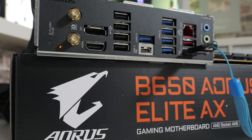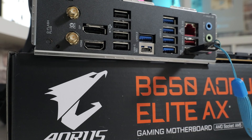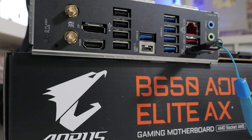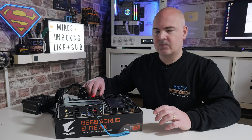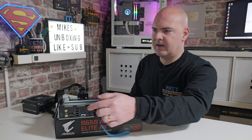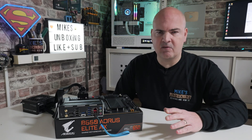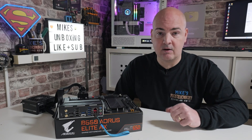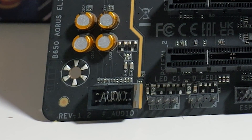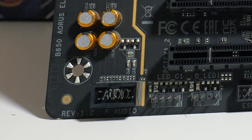We're still flashing away. The flashing speed appears to have changed a little bit — just leave it, let it go on and do its thing. It should take around about three to five minutes depending on the speed of your USB drive and the system. At which point the system should shut down, do a restart, and come back up. Your diagnostic LED next to the RAM will probably be lit saying CPU because there isn't a CPU on there — don't worry too much about that. If you want, set a timer for around about five minutes. If it goes on much longer than that, turn it off and try again. Do check the files on your BIOS drive, make sure it's all correct, and you've got the right BIOS revision for your motherboard — revision 1.2 is written in the bottom left-hand corner.